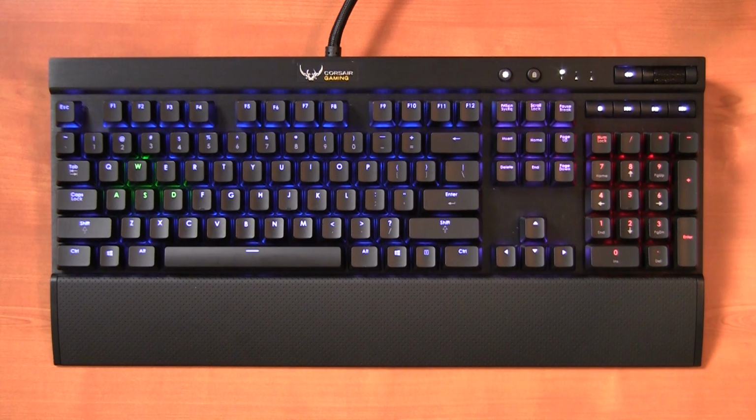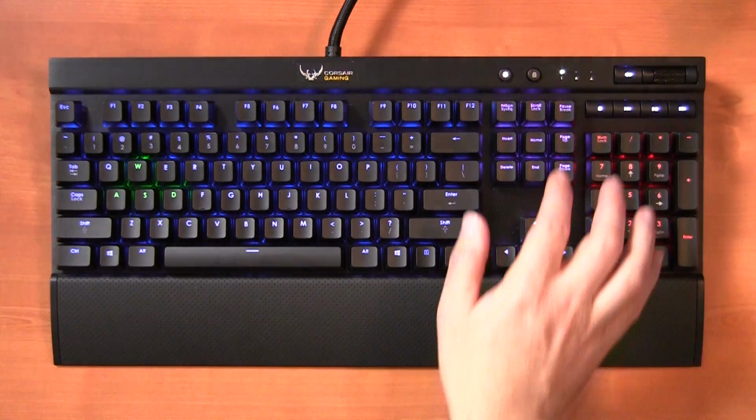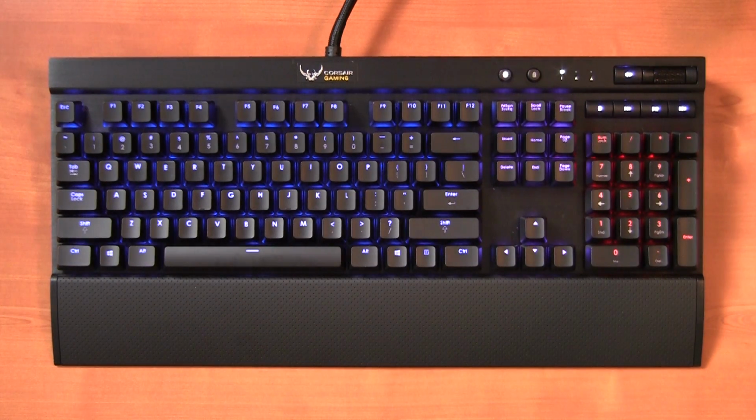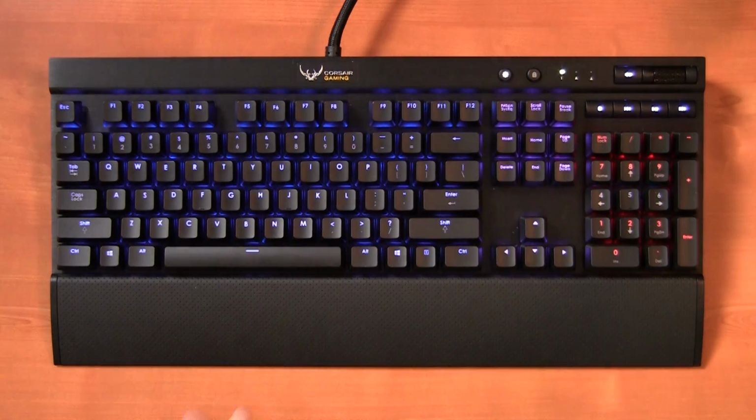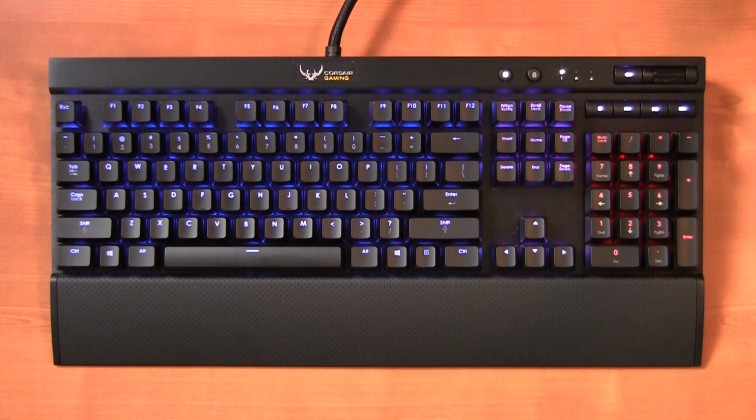And what's happened over the years is that keyboard manufacturers, to reduce costs, have switched out the actual button mechanism with membranes. You probably don't even notice the difference, or wouldn't realize it at first, because you press the keys, they register, and you're happy. But the way the membranes work is that you have to bottom out the key. You have to press it all the way to the bottom to make contact. Mechanical keys, on the other hand, don't work that way. They have physical switches for each key, and when you press those keys, you actually actuate the key press.